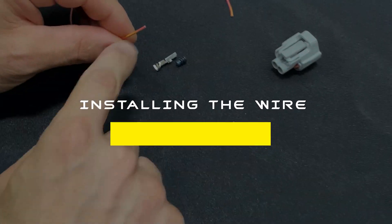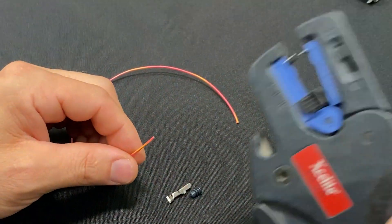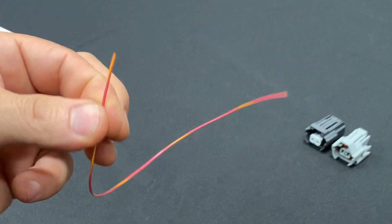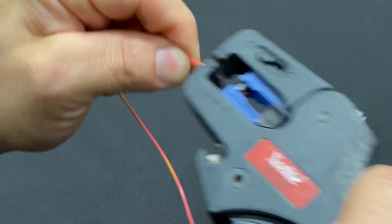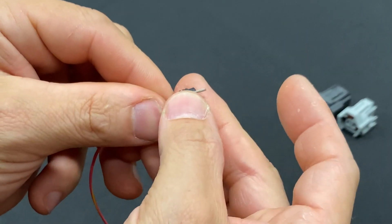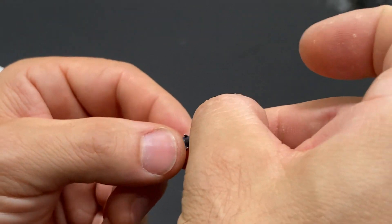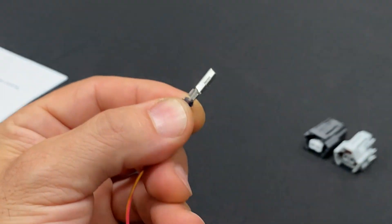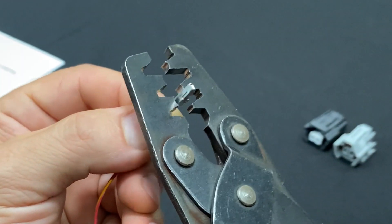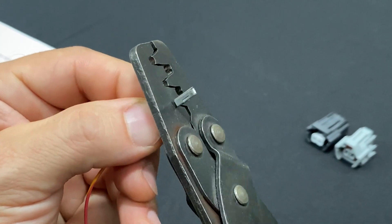Next, I'm going to show you how to strip a wire, put a terminal on it, and install it into an injector connector housing. First, I'll use my wire strippers — these are made for Tefzel wire, which this is 20 gauge Tefzel wire. I'm going to strip a little less than a half inch, install my wire seal, then use my index finger and thumb to support the terminal with just the stripped part showing. Then I'll use my W crimper and crimp down, making a nice crimp with a little tension.